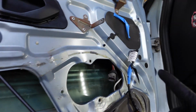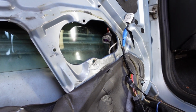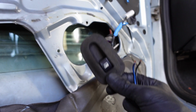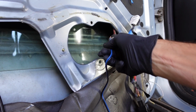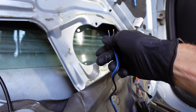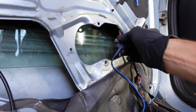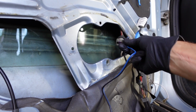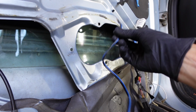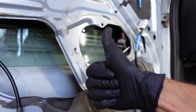I must add, you must check first the polarity. Now I know it switches polarity, but if you don't get the polarity right, this switch will work the opposite way it should. So jam the wires in, up or down, see what happens, and if it's wrong, the other way around. Make a note, red to black or red to blue, whichever it is, once you've checked the polarity, as in which way round these two wires need to connect.